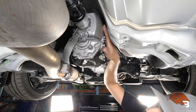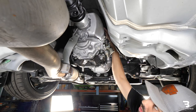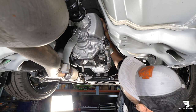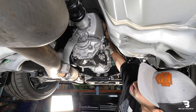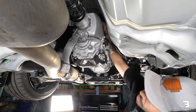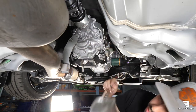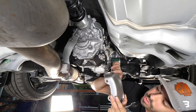So the fourth bolt that I told you guys about is up top here. I found it easiest to reach around from the front. You can't even really see it, but you'll probably be able to see my finger here. It's right where my finger is. What I do is get in from the front of the transmission and use a crescent wrench — get the box end of the wrench on here — and being in the front I have some clearance in the trans tunnel to use the wrench. You can see this cover right there has a bolt running 90 degrees into the transmission.